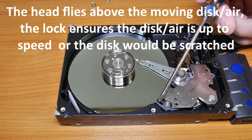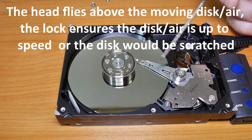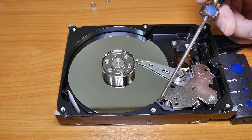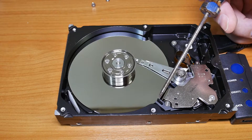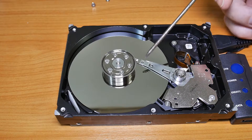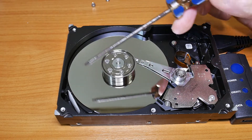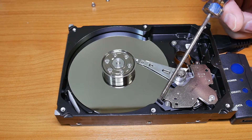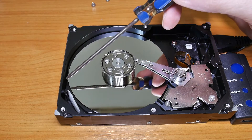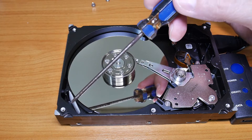There's a lock over here that when the disk is spinning it will unlock the head, so it allows the head to move. This is how the head is prevented from moving when the disk is not being used, and also keeps the head from scratching the disk. Also, while the disk is spinning like this, there's air rotating around and that's what causes this to unlock. Another function of that air spinning around is it goes down through this little channel over here and gets any particles trapped in this little filter right there.